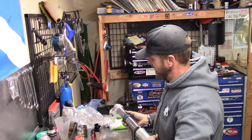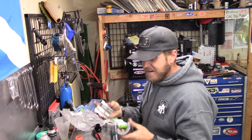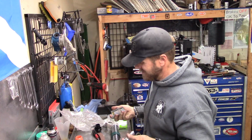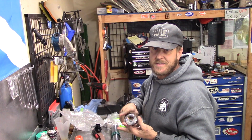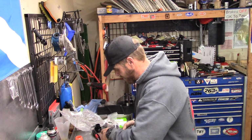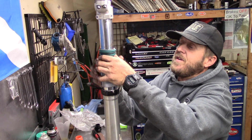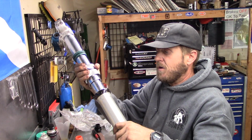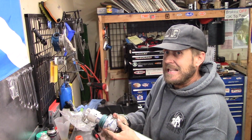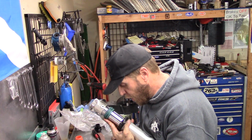Come in here like this. Take your fork seal driver, again, link in the description. A 48 millimeter fork seal driver will work on any 48 millimeter fork. So Yamaha, Honda, Kawasaki, Suzuki, KTM, Husqvarna, whatever. But we take that. Then we come around here. And first we're going to drive the bushing into place. So you hear that change? That's the sound of that bushing going home where it needs to be. Go to your home!